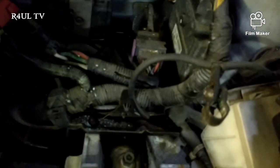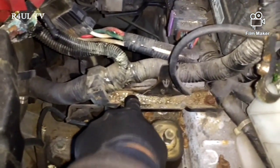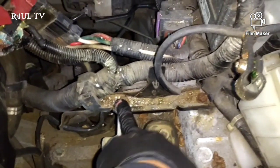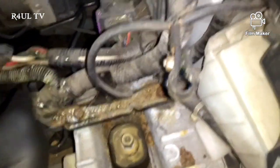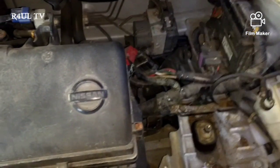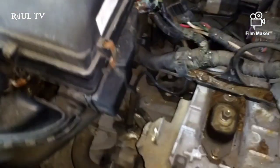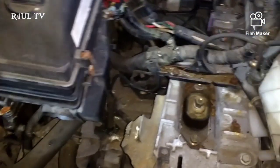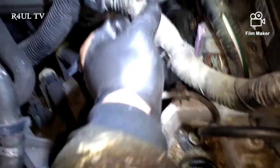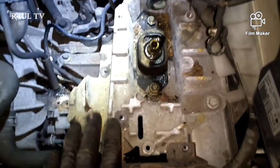I'll turn the light on so you can see it better. Take that bolt off and that bolt off - I think they're 13mm on Japanese cars, maybe 12 or 14, but I think these are 13. Move it to the side, get a cable tie and just tie it up against something so it's totally out of the way. You can take the air filter box off to give you more room. I'm not gonna take the full box off - you don't need it. I'm just gonna take the bottom half of the air filter off. Flip off here, flip off here, take that off - it should just come straight off.